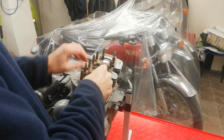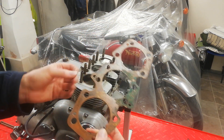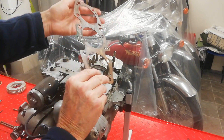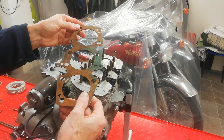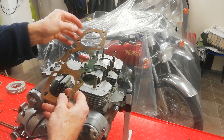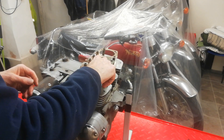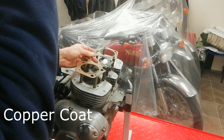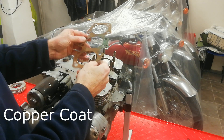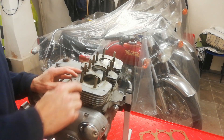This is a copper gasket, so you can actually reuse it. What you can do is anneal it — we'll look at that later on. Unless the gasket is actually damaged, you can reuse it by heating it to cherry red and then quenching it in cold water. That re-softens the copper so you can use it again. There's a spray called copper fix or copper seal you can use with it. I don't tend to reuse copper head gaskets, so I won't be reusing this one.